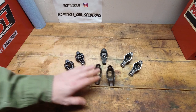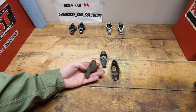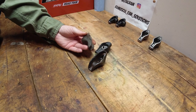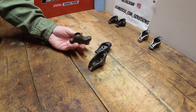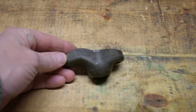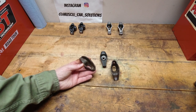Now let's look at the different types of steel bodied rocker arms. First up is the old stamp steel or cast bodied factory stock rocker arm. These are okay up to about 5,000 RPM. Beyond that you start to get deflection in the material — they don't handle lift very well and they're not very strong. For a stock application under 5,000 RPM, a torque engine, off-road, low RPM with a lot of torque, these are probably just fine. If you're going to spin it higher than 5,000 RPM, you need to look at a different rocker arm.